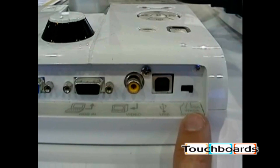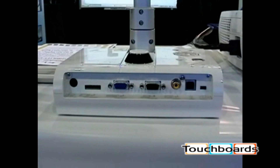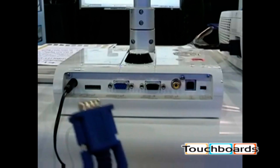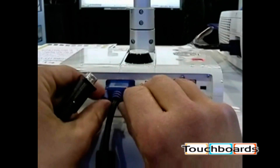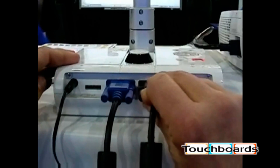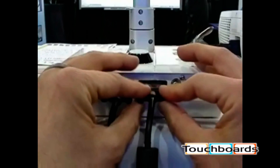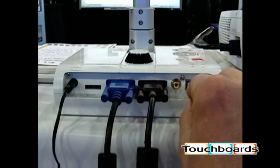Please check with the manufacturer of your projector to make sure that you set the switch to match the resolution of your projector. Setup is a snap: we plug our power in, we plug our cable that goes to our projector, we plug our cable that goes from our PC to the Elmo so you can pass the computer signal through to your projector, and we connect the USB cable so I can use the software on my PC.